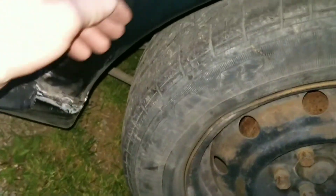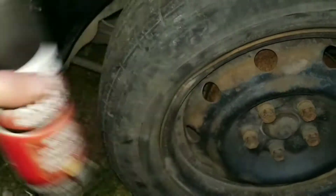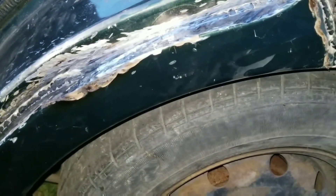We got that piece welded in — Brad grinded out the welds and they look great. When you shut the door it looks real good. Right now I'm just going to spray some rust reformer over it, just in case it rains, to keep it from rusting. Then we'll do the filling tomorrow. This stuff will come off with a grinding wheel or wire wheel real easy, so we're just putting it on to protect it.